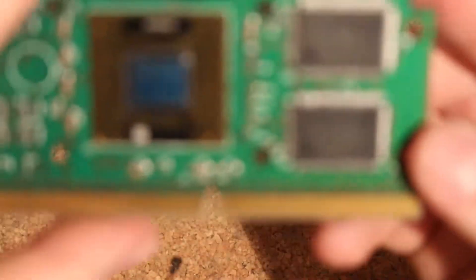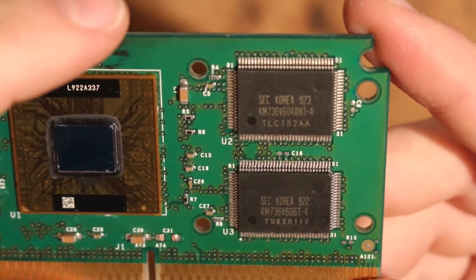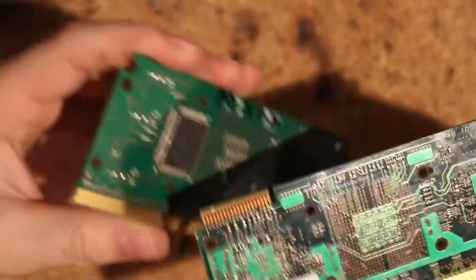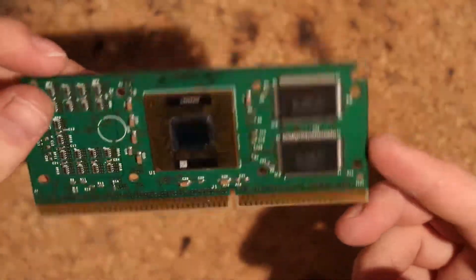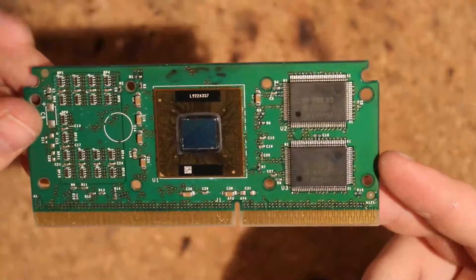As you can hopefully see, those are two different part numbers. The top one is the original Intel cache, the bottom one is the one from the AMD chip. A curious thing I noticed while soldering is that the AMD chips don't have a tag chip anywhere - I guess they integrated it into the CPU. Hopefully that's the case at least, because integrating it into the cache wouldn't make any sense. So the next step is to throw this in a system and see if it posts.